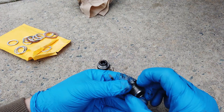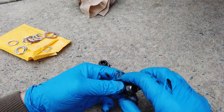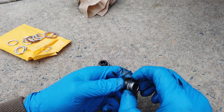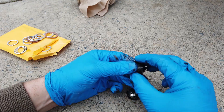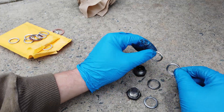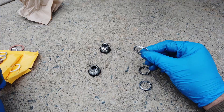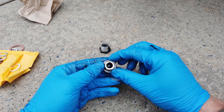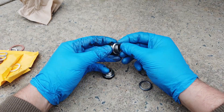Real quick while we're out here — this is our drain plug and this is our drain plug crush washer. The kit I showed you comes with new crush washers. Here is the fill plug, and it looks like they use identical washers. The kit I recommended comes with new ones. We'll replace those after I get these completely cleaned up. So what we're going to do is put our new crush washers on the fill plug as well as the drain plug.